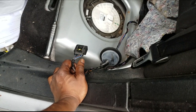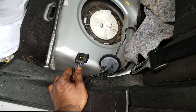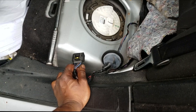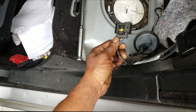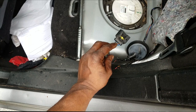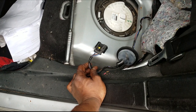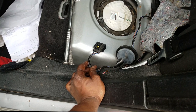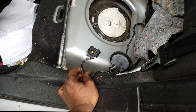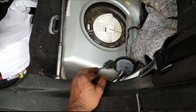I've had customers and shops bring cars in because they put one, two, even three new fuel pumps in and still wondered why it won't start. The fuel pump's internal electrical portion is also rewired, so it doesn't even recognize the previous connector. You can manually cross the pins to put power and ground where they need to be, but you're never going to start until 12 volts and ground get to the pump in the correct order. Placement is of big importance.